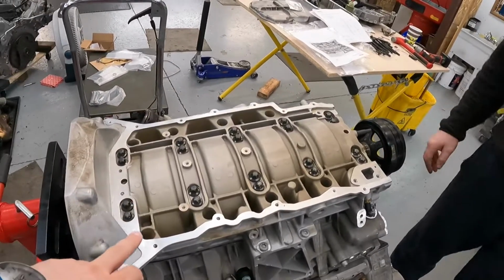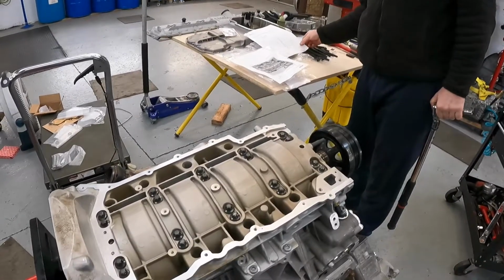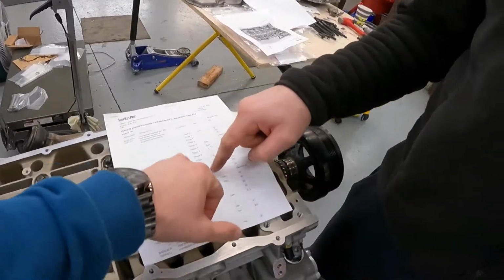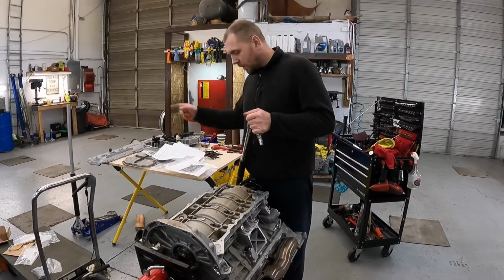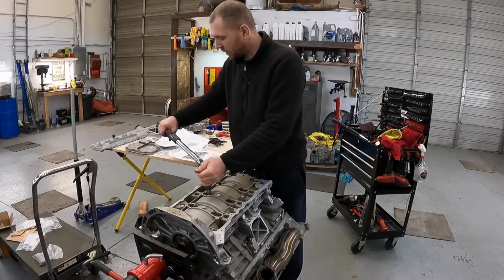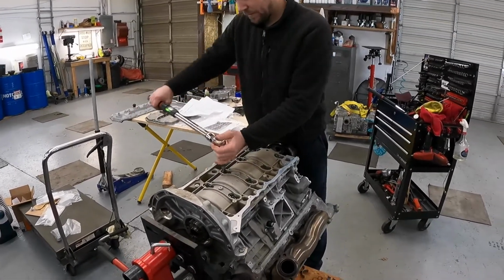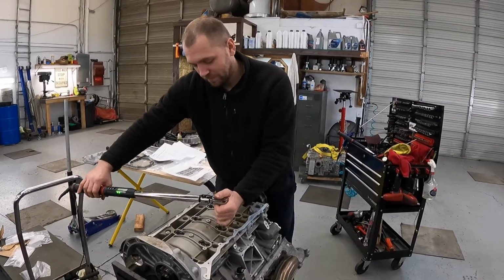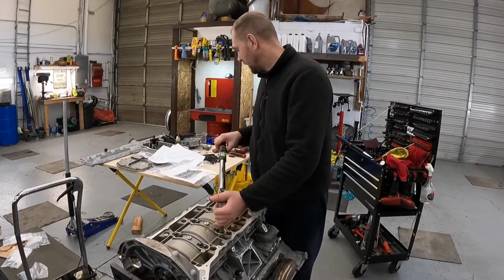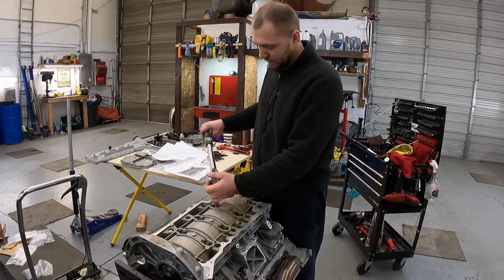Pieces on, we're doing a sequential setup, steps 1 through 9 for how to tighten these bolts. There are 9 stages for each bolt. We have to start from 20 newtons and go in order: 1, 2, 3, 4. This is number one, 20 newtons. Another 20 newtons. 20 newtons. It's a really light torque. Okay, this number, 5, 6.